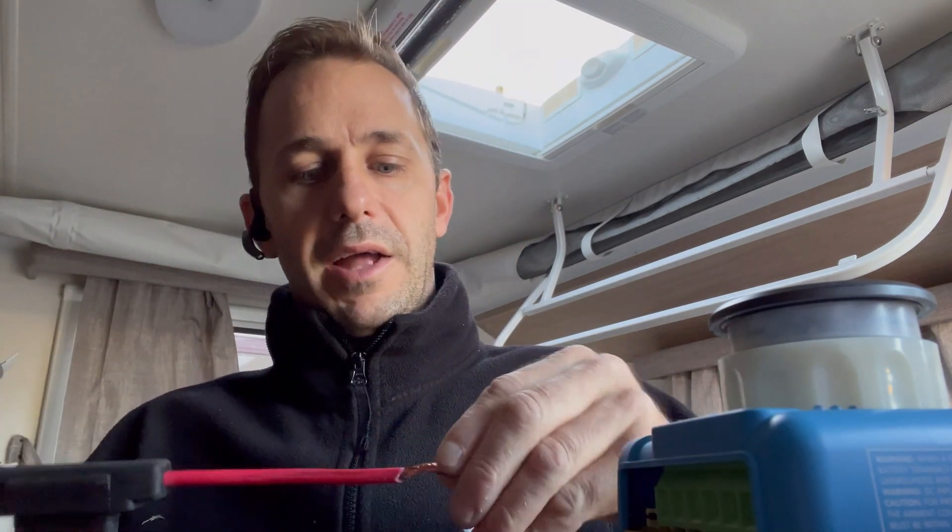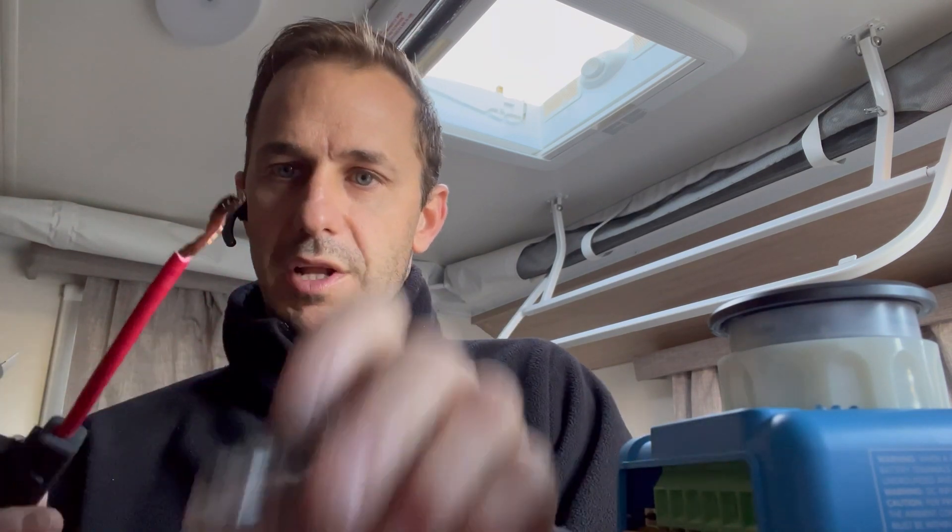It's a connection — you're trying to get power from one spot to another with as little resistance as possible. More and more people are upgrading to lithium, like I'm doing on this Jaco now — putting in battery monitoring, a new solar controller, more solar, going from a 120 amp hour AGM to a 150 amp hour lithium. Because of that I have to change this whole thing. I can't leave it like that — I'll look at every spade terminal, every little thing. Once you put a lithium battery in with such low internal resistance, it loves being charged, so more amps come down the line, more heat is generated, and it'll expose flaws in an already possibly faulty system. Poor quality crimps, poor quality joins — if I just drop the lithium in, I can guarantee that would have melted even more.